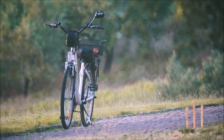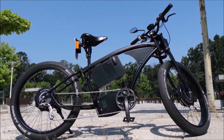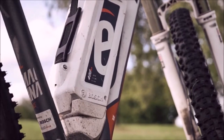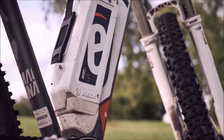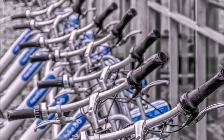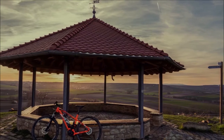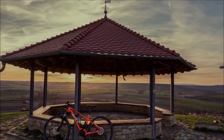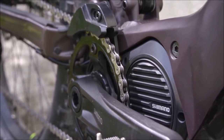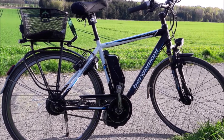Batteries: the batteries are the most important parts of the bike, because if you don't do any pedaling, they contain all the power that will drive you along. Typical electric bike batteries make about 350–500W of power — that's about 35–50V and 10A, which is about a quarter as much as you need to drive an electric toaster. In theory, you could use any kind of battery on a bicycle. In practice, however, you want to use something that stores lots of power without being too heavy, or you'll be using half your power just moving the battery along. That tends to rule out heavy lead-acid batteries like the ones that start cars, though some electric bikes do use them.